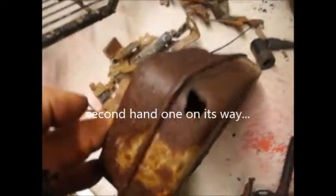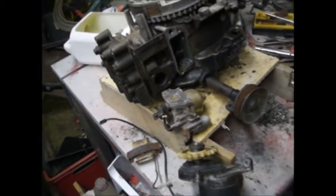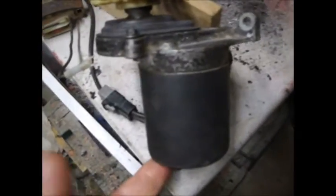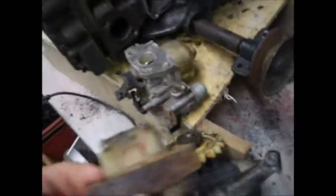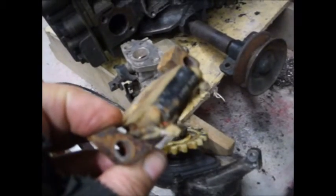A few days later — I've given the engine a bit of a cleanup. I drilled out that broken bolt. I found the carburettor and the starter motor. I rebuilt the starter motor because it was seized solid — some water must have got in it. It has a phosphor bronze bearing in the bottom that needed cleaning; I greased it all and put it back together. Tested it on my car battery and it works great. The carb will need a good clean. That second coil — it charges the battery for the electric start, just like a coil that puts charge into the battery.